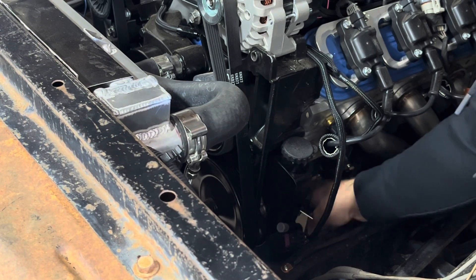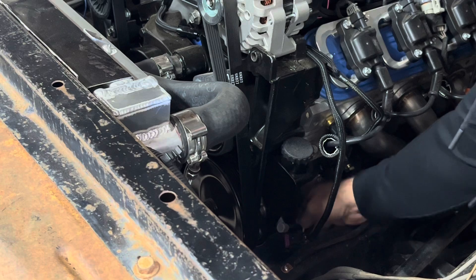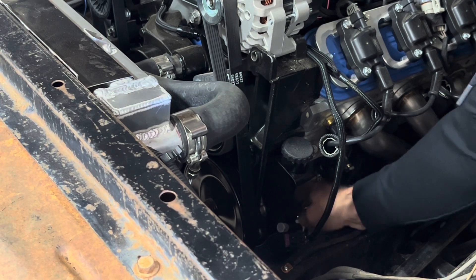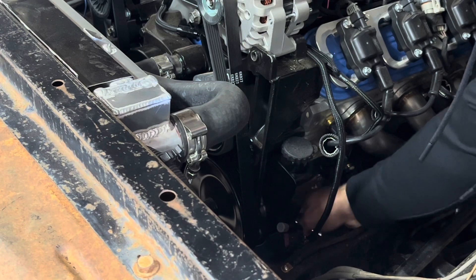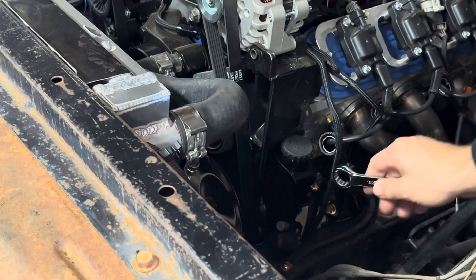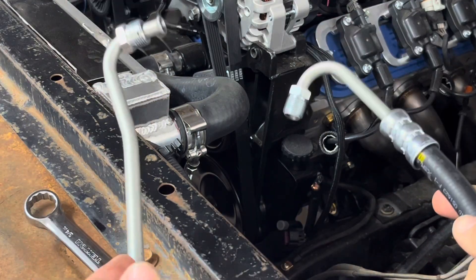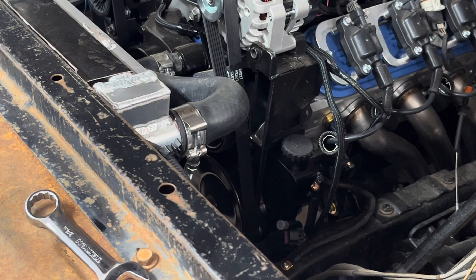Just take your time. You'll know when it gets tight. Now get your pressure hose — it's just your factory replacement style and you can see it has three-eighths flare fittings on both ends. I recommend threading it into the back of the pump first; it makes it a lot easier to route your hoses from the gearbox where they're not contacting the belt or anything. I always like to do the return side last.